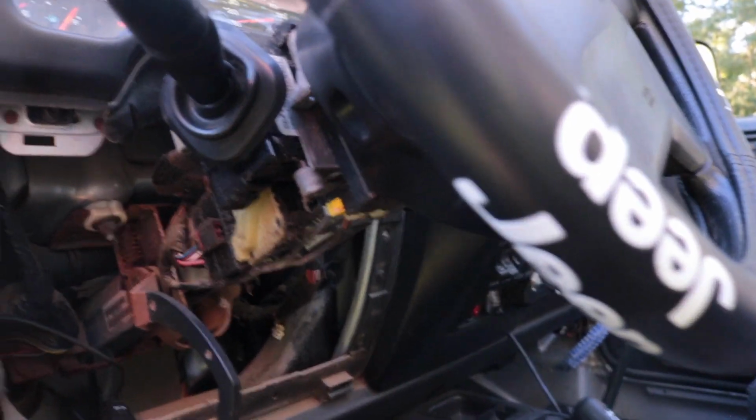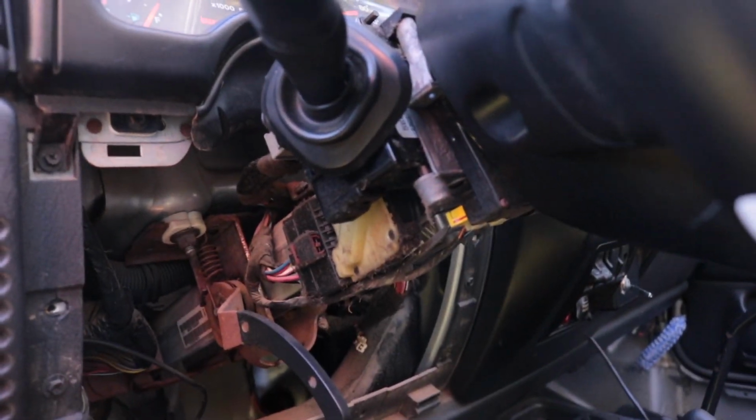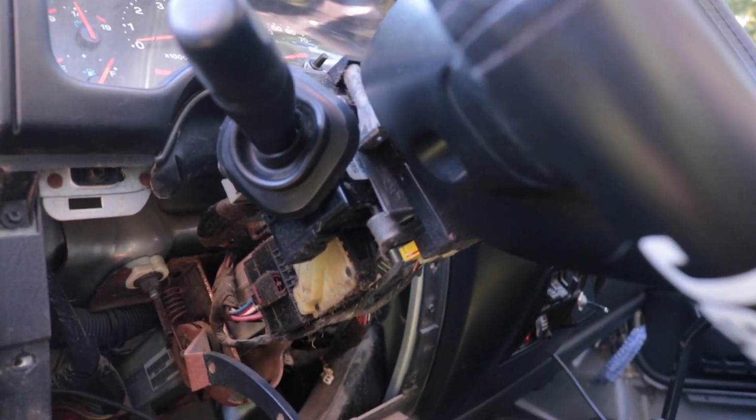If you're doing it on a Jeep Wrangler, all you have to do is remove your two screws here to pull off this bottom cover. Then underneath this bezel here, there's two screws. You'll pull that down and up. Now in some vehicles, like my F-150 that I mentioned earlier, the flasher was actually in a relay box under here. You'll have to look up and see if that fixes the problem. But as far as fixing LED Hyperflash, that's the best method you could use, guys.